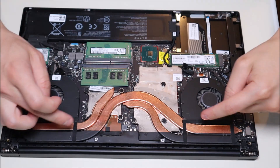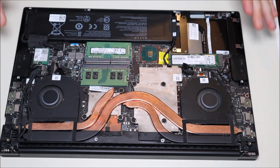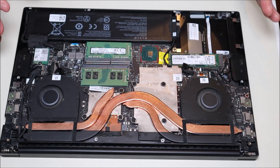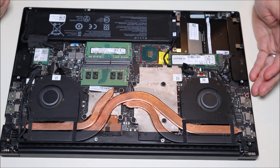You can also see your two fans and your heat sink assembly going over your CPU and your GPU. With any computer repair, the safer your computer can get is directly related to stopping any kind of power from running through it. It's obviously off and unplugged, so the first thing you do in any repair is take out your battery before going after anything else.